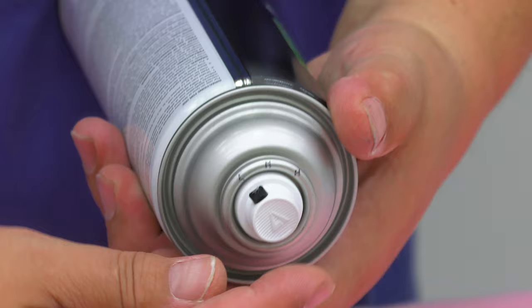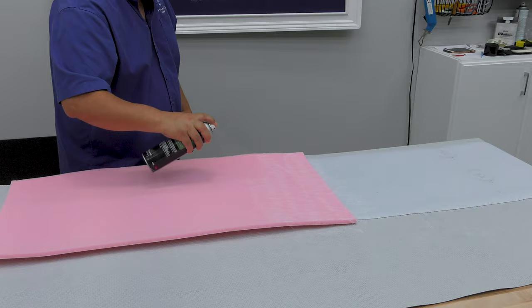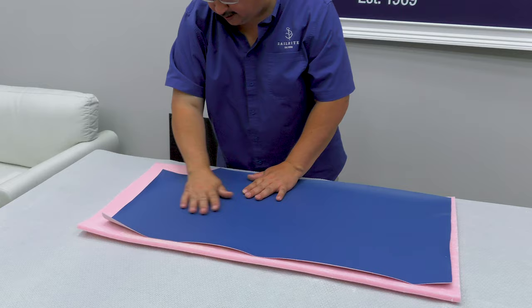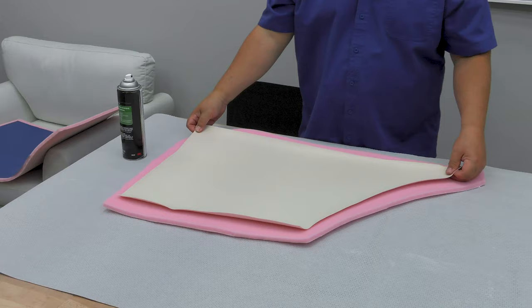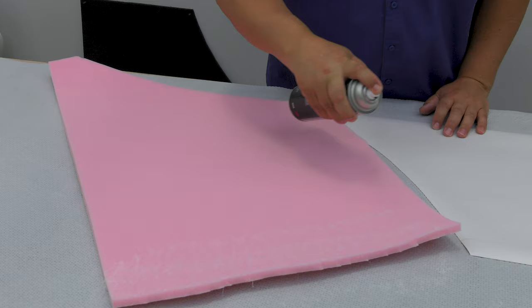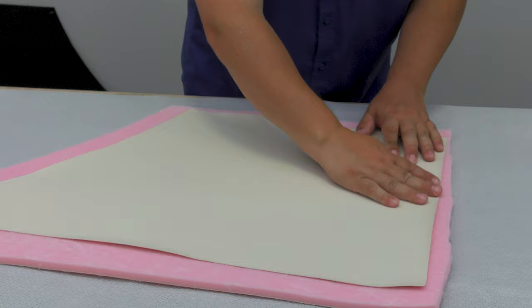That way we can create beautiful pleats. Whether we install pleats or not, the sew foam needs to be glued to the vinyl. On the General Trim Adhesive there's a light, medium, and heavy application — we want to spray it on the light application. We will apply glue to both surfaces: the foam on the back side, not on the fabric side, and the vinyl. Then we carefully place the vinyl on top of the foam. If you get it in the wrong position, don't worry — it can be peeled up as long as you do it right away, but once it's stuck down it will be permanent. Make sure all bubbles are worked out and the vinyl fabric is laying flat. The cream vinyl will not have pleating installed, but we still want to use sew foam there for the soft plush feel. We're applying glue to the side that does not have the fabric backing, to both the foam and the underside of the vinyl, and sticking it in place just like we did with the blue.